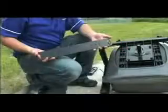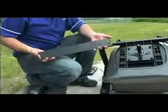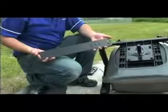An anchor plate will be used for seats with a center seat post. Alternative mounting methods are available. To install the anchor plate, remove the seat and loosen the four seat plate mounting bolts. Slide the anchor plate in place between the seat and the mounting plate. Align the anchor plate with the center seat post, then retighten all bolts securely and replace the seat.